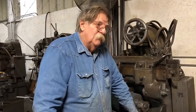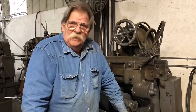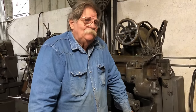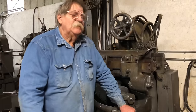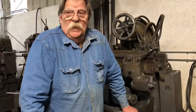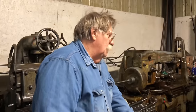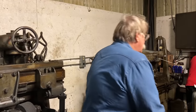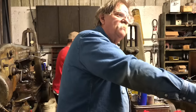Not one of the cleaner jobs in the shop, but it does a nice job of quieting gears. The synchro-trans with straight-cut gears you pretty much just have to let them wear in. I've found if you go about 25 mph in them they break in a little quicker. The prettiest transmissions I've ever pulled apart are overdrives — I think maybe a little heavier oil or people who cared more about changing their oil.